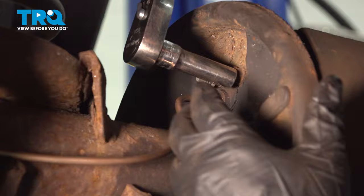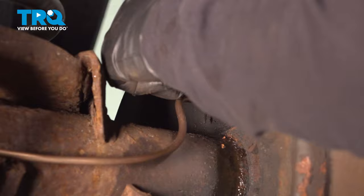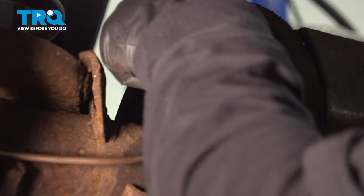That's why you have that catch basin down below. They're not long bolts — they're really short little bolts, like a 6-millimeter. Take one out — see how short those are? Replace them if you feel like you need to. These are pretty rusty, so I probably will replace them.